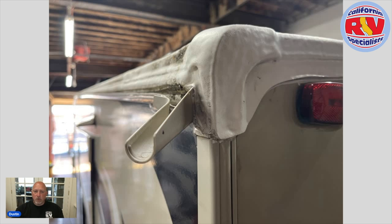I'm not a real big fan of how they coated these areas — I would not have done that myself, coming from the repair and maintenance side. The corner caps are going to shrink, crack, and dry underneath. The insert molding that is starting to come out is, at some point, going to need to be replaced. The sidewall and rear cap moldings need to be tightened up because of flexing, and in doing so, we're going to have to compromise the coating that was installed.